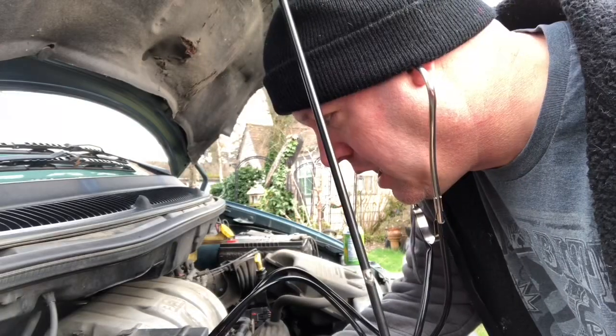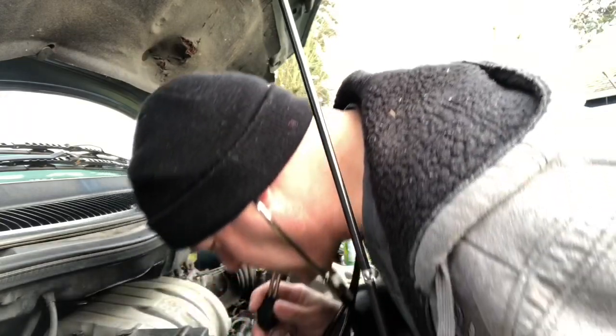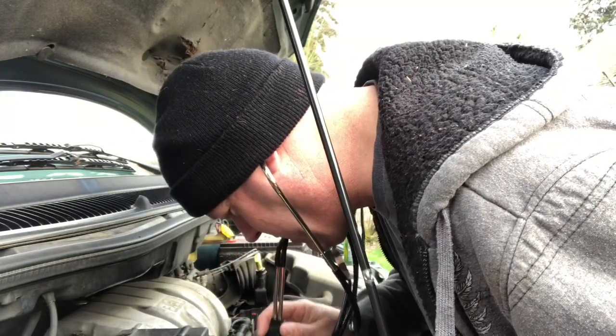But sometimes the way the belt's tightened on there, it did tend to have some slop in it. I noticed before I unbolted it, a little bit of slop in the wheel. So that probably indicates that it was maybe knocking up against something in there as it was spinning. I don't know, but we'll put a new one on and go from there, see if that fixes the loud, well, this. I really don't hear much from the water pump at all.